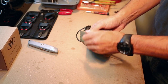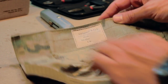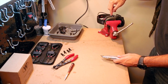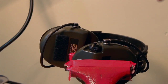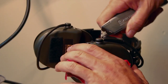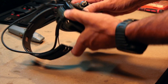Start by removing the fabric that covers the headband — not strictly necessary, but you get to see it was made in the USA, and that makes me feel good. By inserting the ear protection into a vise, you can create a more stable platform to use the knife to cut off the shrink wrap tubing that holds the communication wiring. There's no need to clamp down particularly hard; just enough that the ears don't move. I place some tape over the jaws to limit any scuff marks on the ears.